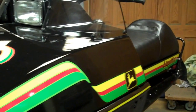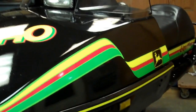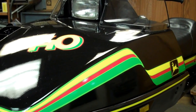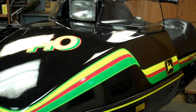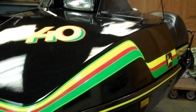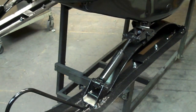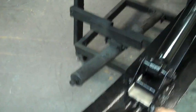It has a brand new snow stuff windshield with these cool-looking window darts that really make it look clean. It might not be completely original — the original was just a screw — but the screw is under here, it's just these plastic caps to clean up the look. The '78s were kind of a sled of their own. I looked on the JD website last night and they made around 2,000 of these 440s, from September to November. I put new wear bars on the skis and these ski shock absorber plates where your leaf spring rubs.